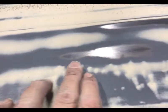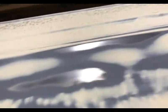And here, if you watched my video where I put the epoxy on here, I was talking about all the little pop marks in the fender. Well, here's what the poly did with those, and they're pretty daggone good. So I think I got some bare metal spots here. I have to spot epoxy primer. Pretty good shape, but then again, here's this other one, off the truck, we can see a little better. The low spot there, sanded through there. I need a little epoxy there probably, and then need a little work on that edge, but that's where we're at now.